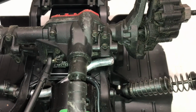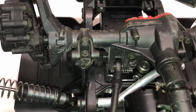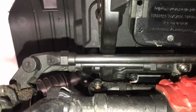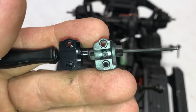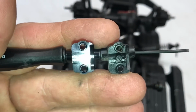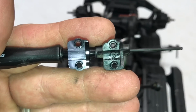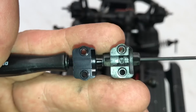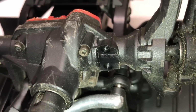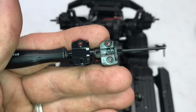Now this one is just simply two bolts: unbolt it, bolt the new piece in. This one's got those same two bolts, but like the one I showed you before, it's got the panhard bolt up in the front. The new pieces are just like the old pieces, and there's actually a recess in that to fit these correctly. So if you find these not bolting into place, you may have it upside down. Just flip it over, make sure that indentation right there, the recess, goes right up against there, because you can see where it actually sits. Get that set up in there, and the bolts go right into place.